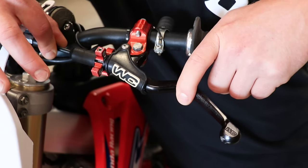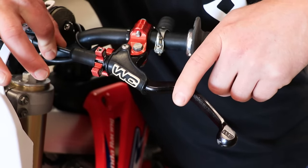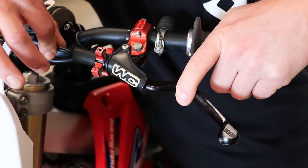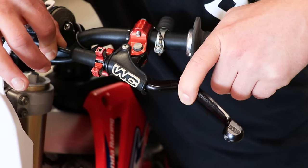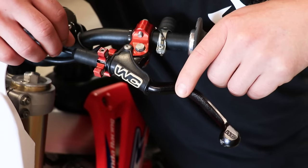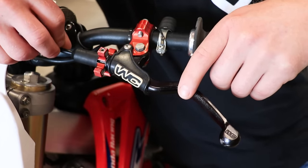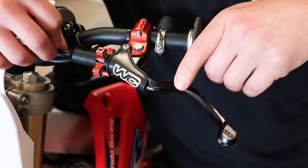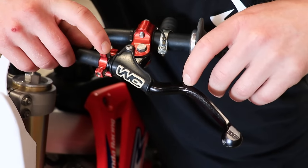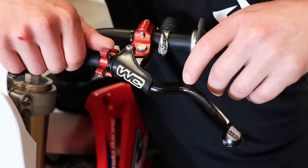What we're looking for here is a little bit of play in the lever. Hold tension to the cable, pull it out a little bit, and work the cable and lever back and forth. You'll be able to feel a little bit of movement. If you don't have any movement here, the clutch will be partially engaged and slipping, which will burn up the clutch plates pretty quickly.